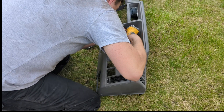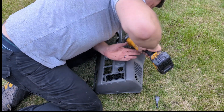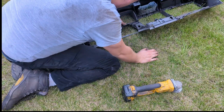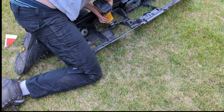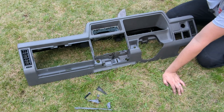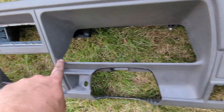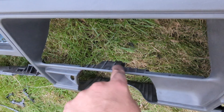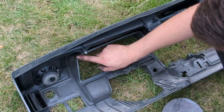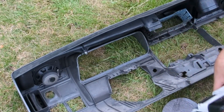I used my trusty grinder with a 1mm cutting disc on the dash. For the corners I couldn't get in with the grinder, so I used a hot knife — heated it up with a blowtorch and it went through like a hot knife through butter. I took my time, bit by bit, until I was really happy with it. Once everything was cut out I smoothed the reinforced areas with a flat disc on the back to give a bit more space. I've also had to cut all the thick edge right back on the rear side, and the ducting was fouling the clock so I heated it with a blowtorch and pushed it in.